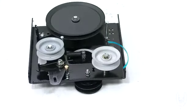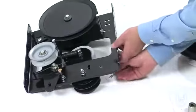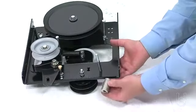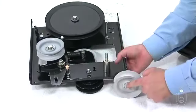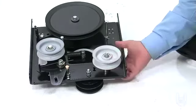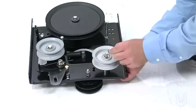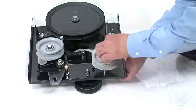Next, you will take the pulley, part 15, with the long end of the hub facing down, and attach it to the clutch idler assembly. Take a hex bolt, part A, and insert it up from underneath the assembly through the bolt hole in the corner. Then place on the bolt first a spacer, part HH, then add the pulley with the long end of the hub pointing down. Then, on top of the pulley, place on the bolt first a washer, part Q, then a lock washer, part T, and secure it with a hex lock nut, part U.